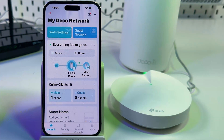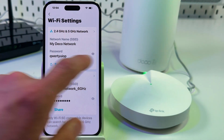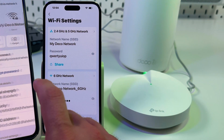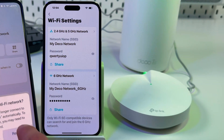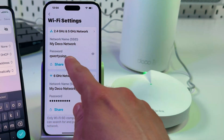Also, if you recently changed your Wi-Fi password and there are some devices you don't use very often, you may need to reconnect them. Tap the eye icon to show your password, then take the device you want to connect to your Deco network, tap the 'i' next to the network name, forget the network, and remove it from your device. Next, find the network again, tap on it, and connect using your new password.